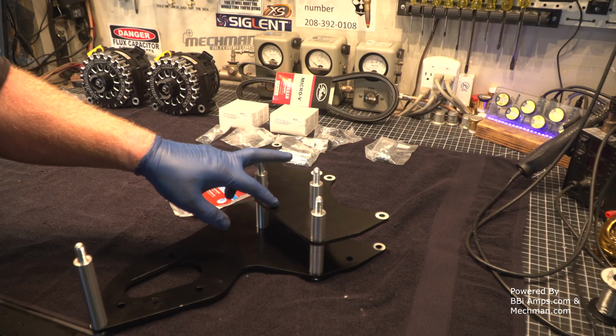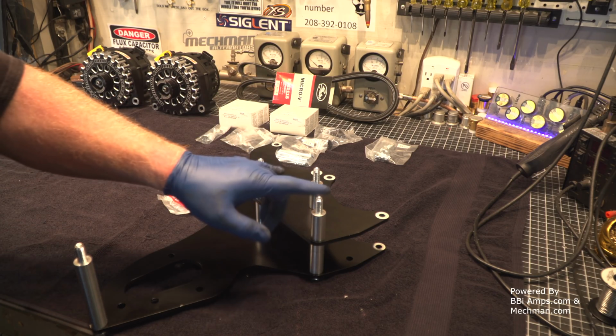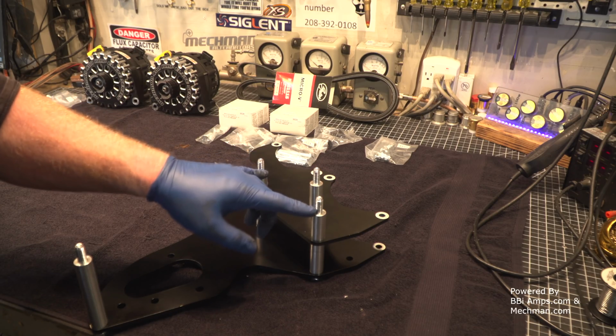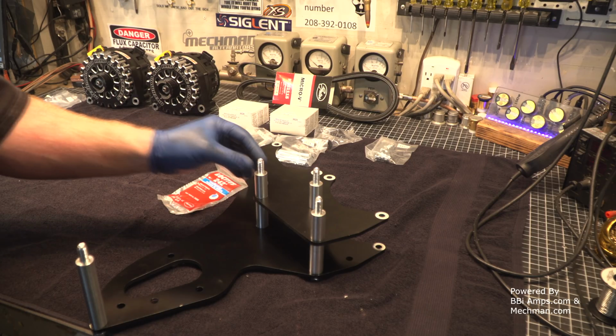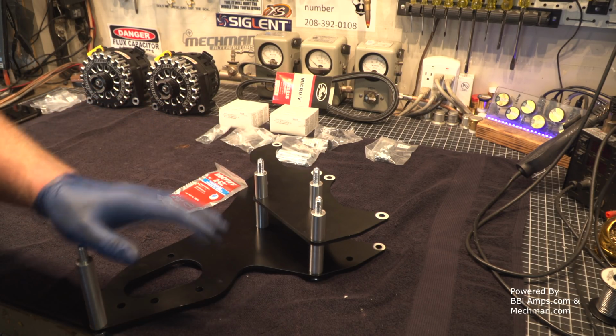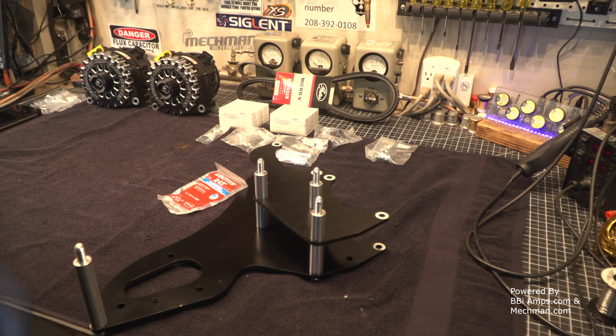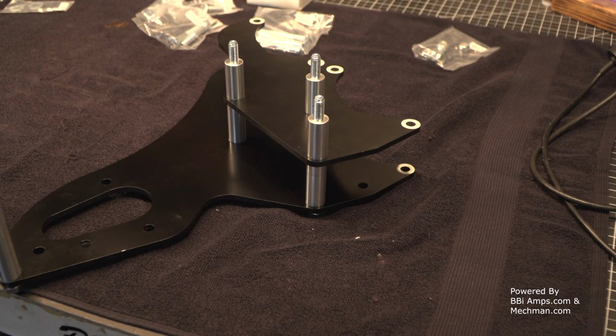These bolts are long. We all know the best way to get Loctite to break free is heat. So thank God this will be all open, so if you needed to hit a torch to this in the future to break these, you can. But we're going to go ahead and start these, just barely start them, and then apply our thread locker, that way it all gets sucked into the mounting holes, instead of out there when we get the plate installed.